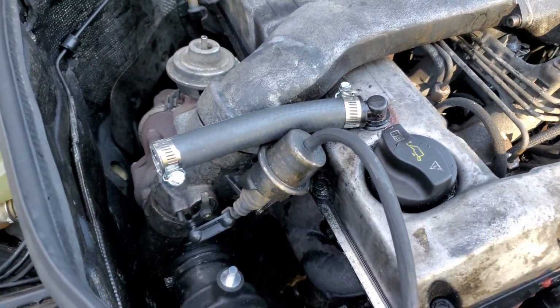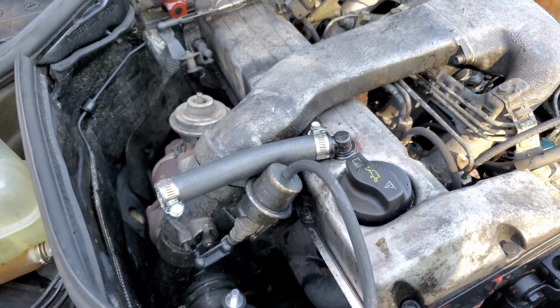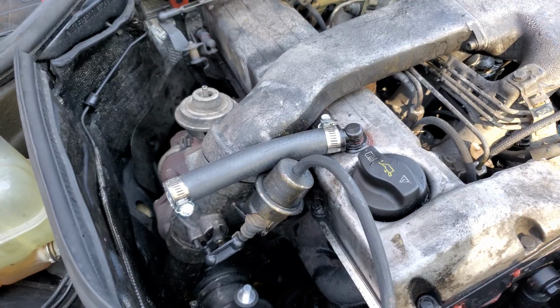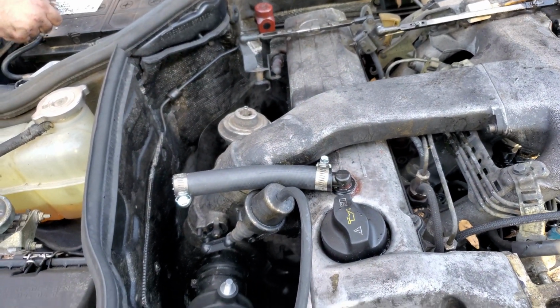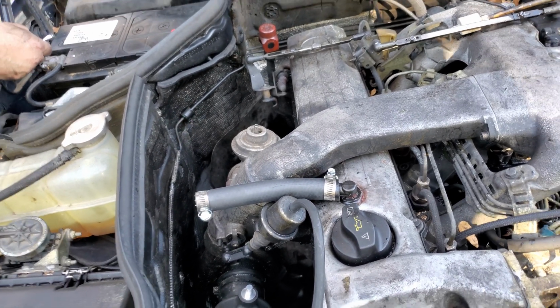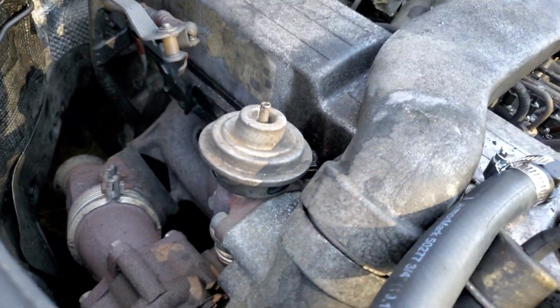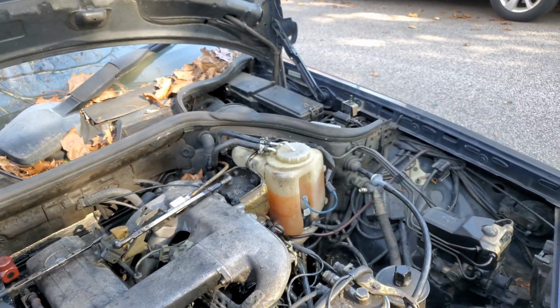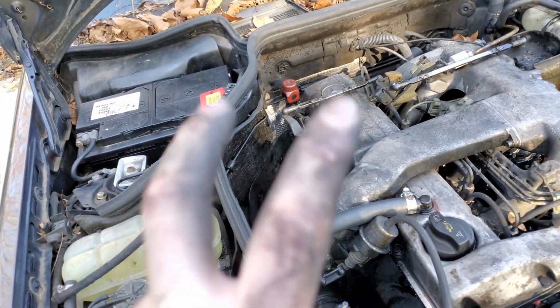We got a catch can to put off of here, but the catch can was not baffled, it appears, so it was basically worthless. But we've hooked up the catch can, and it was still blowing out the other side, so the crankcase pressure is just so high that it just is not going to work with a catch can, basically. Even with one with a baffle, I wouldn't think. We disconnected the vacuum line to the EGR, as well as the vacuum lines that go to the body, because we don't need it. I'm fine with manual locks, and the EGR is basically worthless, off-road use only.